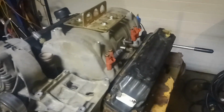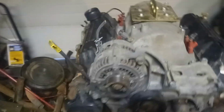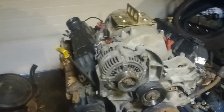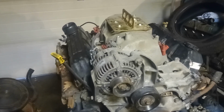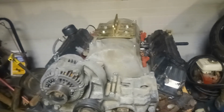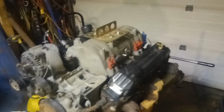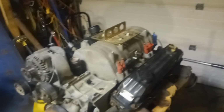I've got to strip it down to see, but usually these Magnums have a pretty good bottom end still, because they don't get the cylinders washed. So we're going to hone it, re-ring it, re-bearing it, re-gasket it, timing chain. I'll do some tweaks on the factory oil pump. It's going to get those heads he has on it, a Howard's cam. He's got an air gap intake for it. Probably put a 1-inch spacer. He's got a 727. We're going to make it full manual, and a 3000 HD Hughes converter.